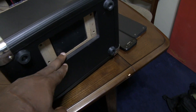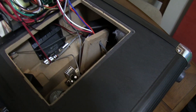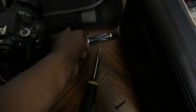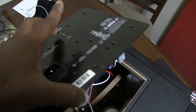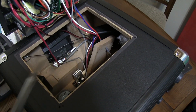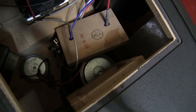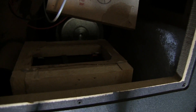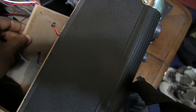Here's the battery right here. The first thing you want to do is unscrew the screws from here, and then unscrew all the screws from around the outside of the panel — that's about eight screws from the outside of the panel. Then you lift this up and you've got to take a flathead screwdriver to pry the wood off the top of the little block that's housing the battery, which is right inside there.